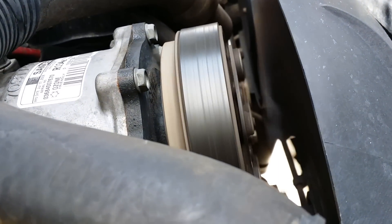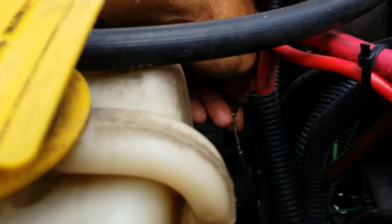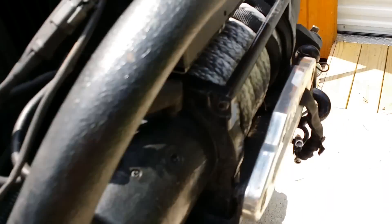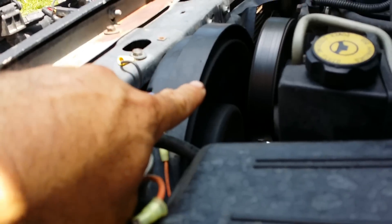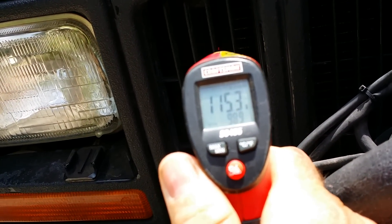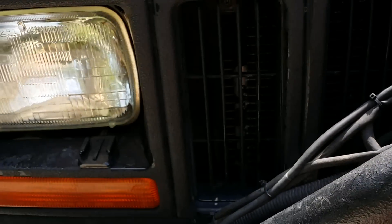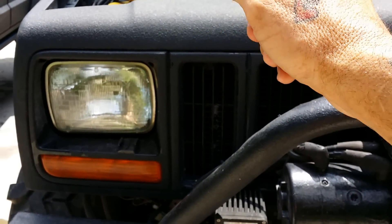You see this wire right here? You find your wire - if you're out on the trail and this is going on, you're running hot and you need to try to cool it down. You see that? Look, running the compressor - you find your wire to your compressor clutch, it's right here on mine. Unplug that to kick the compressor off. Now you're not pumping freon through your system and it'll keep your fan running, and it'll drop - see there, it's dropped down to 97 degrees.